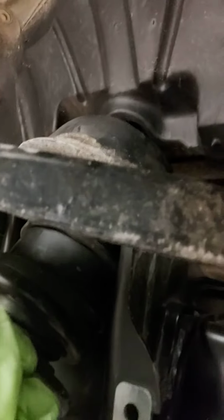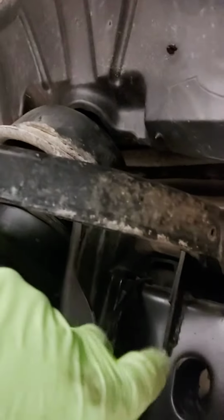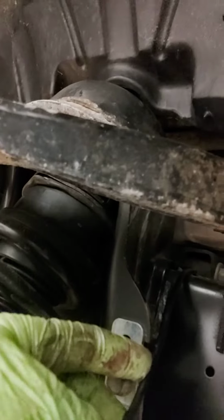And then when you're done, you make sure that you clear your brake line from this area here so that it's not rubbing on this bracket. This is a little tight, so what I normally do is I'll just get in there with a screwdriver, kind of give her a little, and really, 1/16 of an inch is all you really need. Ain't going nowhere. Perfect. Check in later.